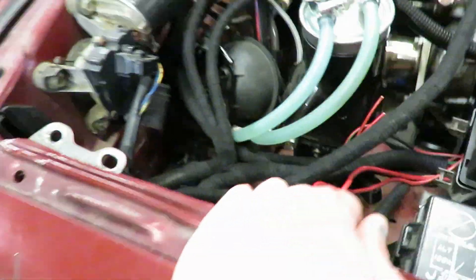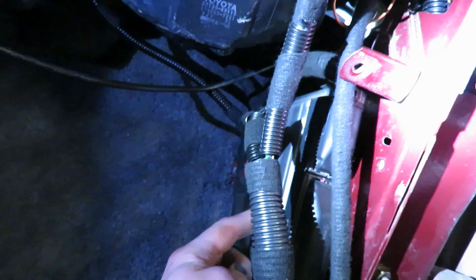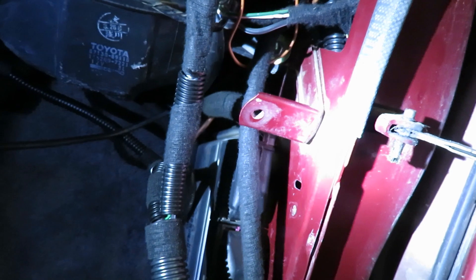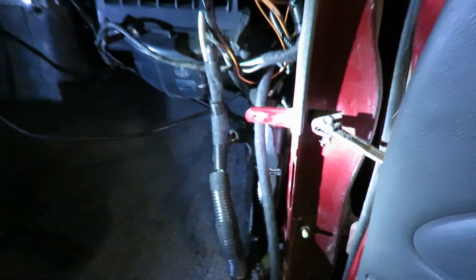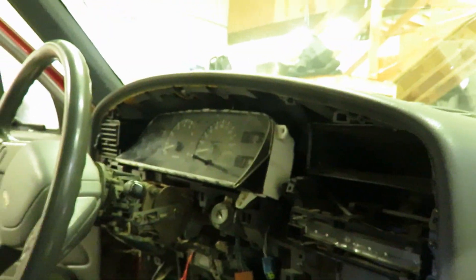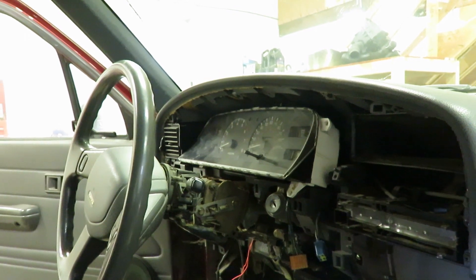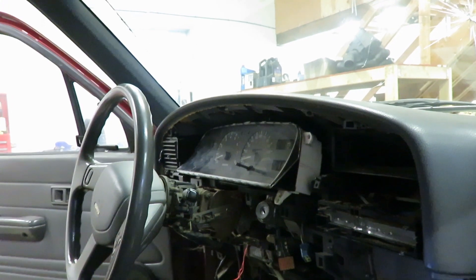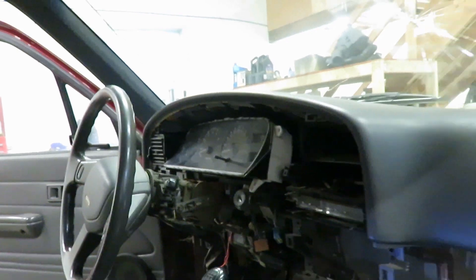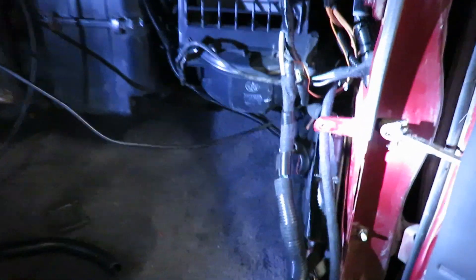It's been a long few weeks working on this wiring and I think I'm finally happy with it. I really wanted that ECU mounted solid but I don't really see a way of doing that in such a small area, so that's gonna have to do the job. One of my biggest things I wanted was the instrument cluster to work - every gauge, every light - and I have accomplished that. We got tach, oil pressure, water temp, volts, fuel level, battery light, glow plug light, check engine light - everything's functioning. That was a big, big plus for me.